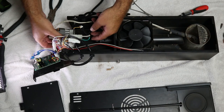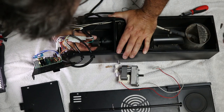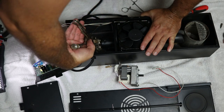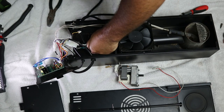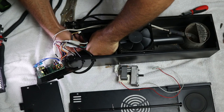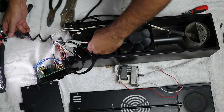If you made it this far, you can now pull out the motor. Next, pull out the auger plug — you may need to wiggle it a bit to get it loose. Time to remove the auger. If you're lucky, it might just pull or twist out by hand. I needed some channel locks to twist it loose from the pellet concrete lodged in the tube, but once I loosened it, I was able to twist it out the rest of the way by hand. Hopefully you have better luck than I did.